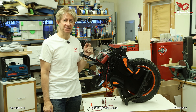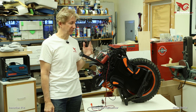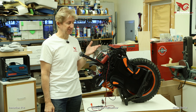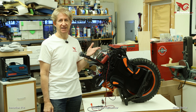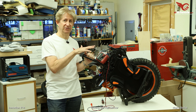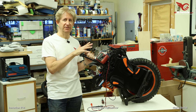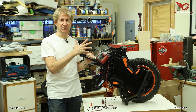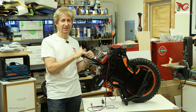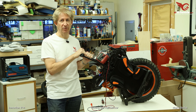The first test I did, based on the recommendation from InMotion, was to open up the control board area and inspect the hall sensor connector and cable to see if anything was out of the ordinary. Remember the failure in this wheel — the initial failure indication was a bad hall sensor, and then subsequently that caused an issue with the control board, which burned up.